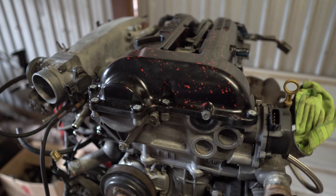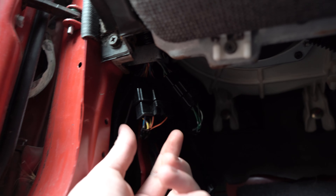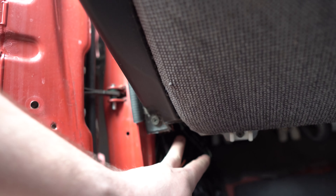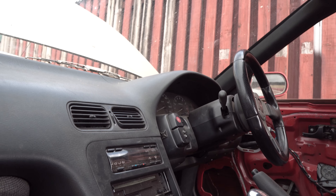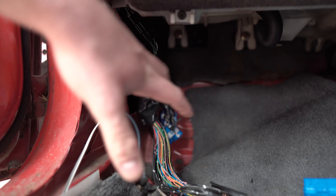I'll show you the car and the wiring side of things I've done. Now I know I said the harnesses are completely different, which they're not - to the engine it's all the same, same plugs because it's the same engine. It's just one's got VTC and one's no VTC. But the difference is the body plugs. So this is the body plugs here - there's one there and another one over here, base, and then obviously the ECU goes in here. These all go to your dash cluster and all that sort of stuff. But in an S14 you've got this one big plug with your relays that goes to all your ECU power, relay power, all that in your footwell.